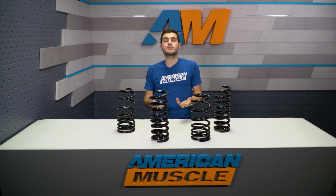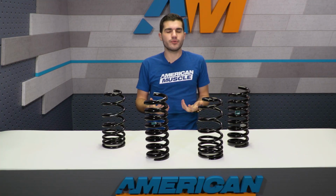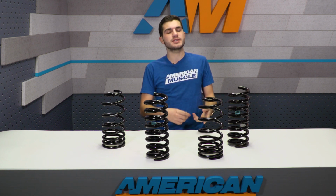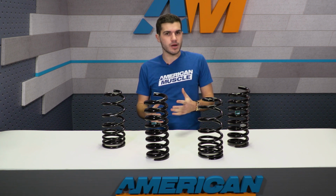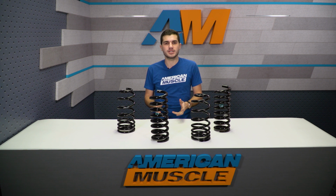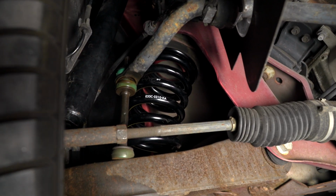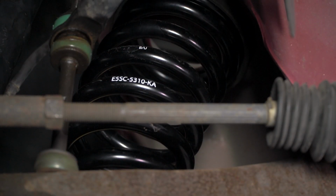So I'll start with the G-Springs simply because they are the easiest to differentiate. The G-Springs from Ford Performance will give you a 1/2 inch drop in all 4 corners, whereas the C-Springs and B-Springs will give you exactly what I mentioned earlier in this video. The C and B-Springs from Ford Performance are only differentiated by the spring rate. The spring rate for the C-Springs we have here will be standard, and the B-Springs offered on the website will be a progressive spring rate.